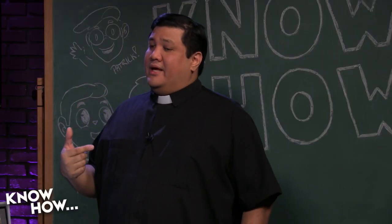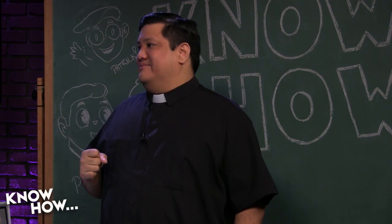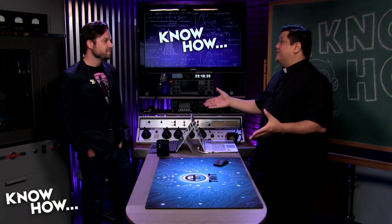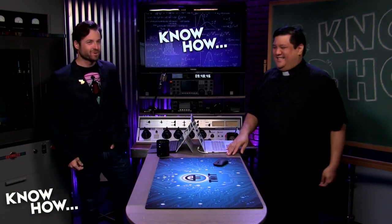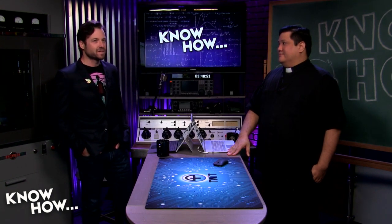My thing is this, though. You know, and I know, that if you shut down a Raspberry Pi incorrectly, bad things can happen. And it doesn't have to be a Raspberry Pi either. It's a little computer. Exactly. If you disconnect the power and not in a shutdown sort of fashion, it can corrupt the SD card that you have. By destroy, you mean corrupting the image. You could reflash. It's not going to destroy the memory itself, and the SD card's not going to explode. But all the work that you did, like loading on an OS or updating the software, is going to be undone, and you'll have to redo that.